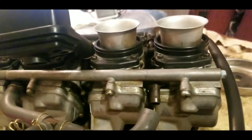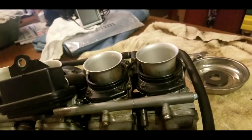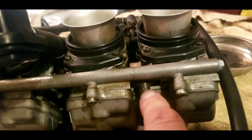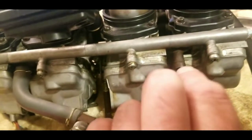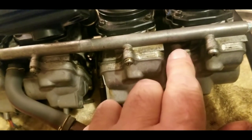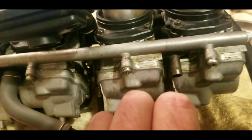There are two fuel lines that feed the carburetors, one on the left and one on the right. They hook to these little pivoting T's here, which then sends fuel to both carburetors on either side. The main fuel comes in through this tube right here, splits, and goes both ways. Our leak is here around the o-rings going into the carburetors at numbers three and four.